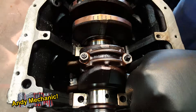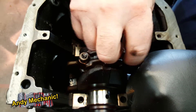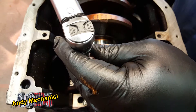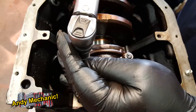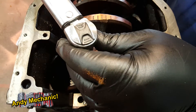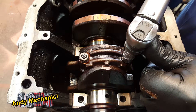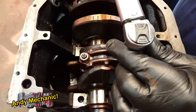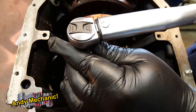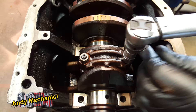Put the bolts on. The torque setting for these is a two-stage torque setting, and you've got to do them right up to torque, otherwise your reading will be wrong. It's 24 Nm for both nuts, and then a 90-degree turn, and then we should be up to the right spec. You've also got to do this without rotating the crank — make sure the crank stays stationary. 24... and 24. Now for the 90. That's tight.